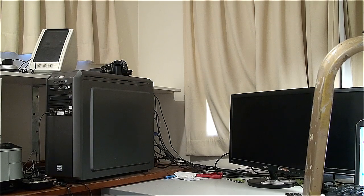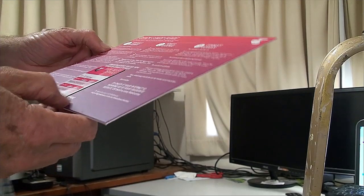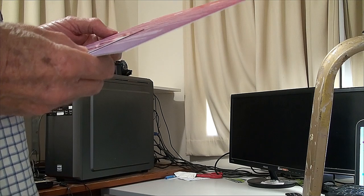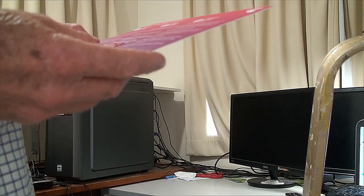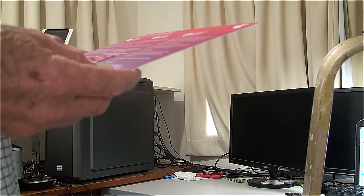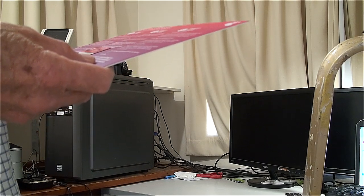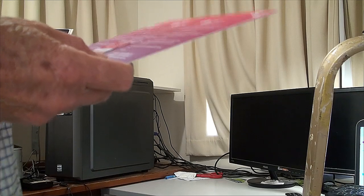Go back to the instructions on how to connect the gateway. It says wait until the connection day before installing a new gateway. You've got to read the warnings on the other side — you can't have many alerts, alarms in here. Unplug any existing modems — we've done that. Telephones and other devices such as a fax that use the telephone wall socket. Pick up the cable with the grey plugs on the ends, matching the colours and the names. Insert the grey plug into the grey DSL port on the gateway, and insert the other end into the wall phone socket.